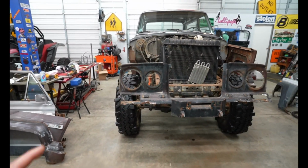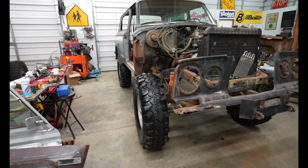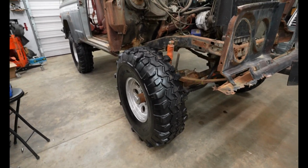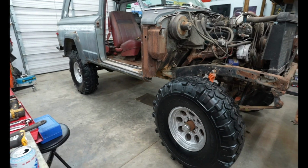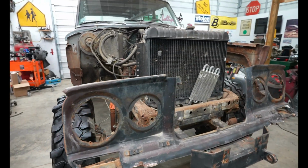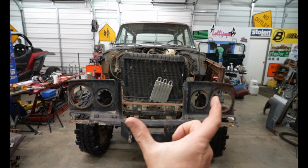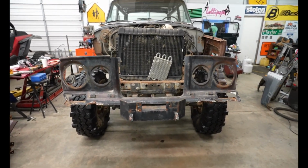In the last video, the last thing y'all saw me do was I basically tore everything apart and kind of went over my build plan, and then I ended up putting the tires and wheels that I'm going to be running. These are 38-inch tall Super Swampers, TSLs, and I'm going to be dove nosing the front here. If you're not familiar with a dove nose, it's when you take the front grille and you basically just pinch it in just like that so that it gives it a more aggressive look.